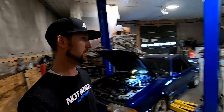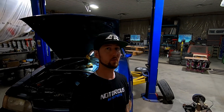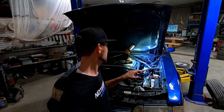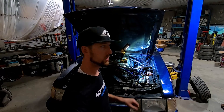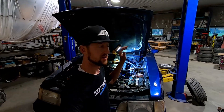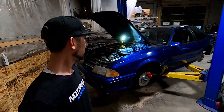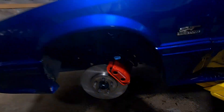Getting this master on — Dale's just stepped out for a bit, and when he gets back we'll get this thing bled up and maybe even get to take it for a roll down the driveway to test all these brakes out. We've finally reached the end of the road on the five-lug and Cobra brake swap. The master cylinder is in, the 3-2 line conversion is all done up and tightened, routed, brake fluid level sensor all connected back up. We bled the master once it was in the car, then bled all four corners — everything's nice, clean, fresh fluid.